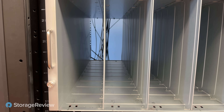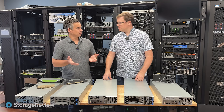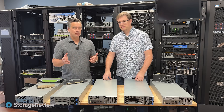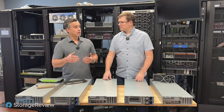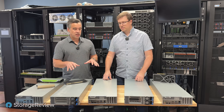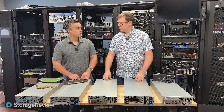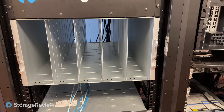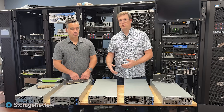The chassis is more like a box around the nodes, but that also has some advantages for certain deployments. The chassis just has a couple of little catches to slide the nodes in on. When you think about blade chassis, they generally share a lot of resources including sometimes out-of-band management and power. These being distinct really isolates them from the other four nodes in that 6U enclosure. It's cost-effective blade deployment — they don't have the features of a traditional blade server, but they don't have the cost either.